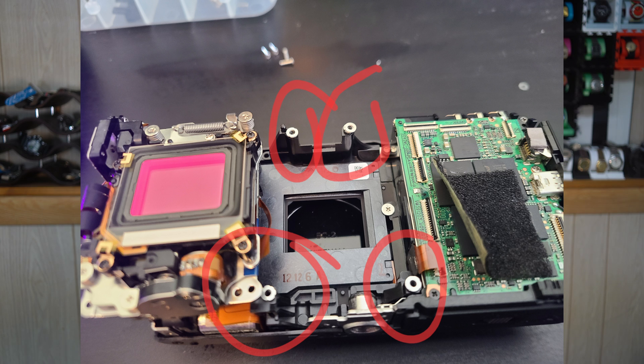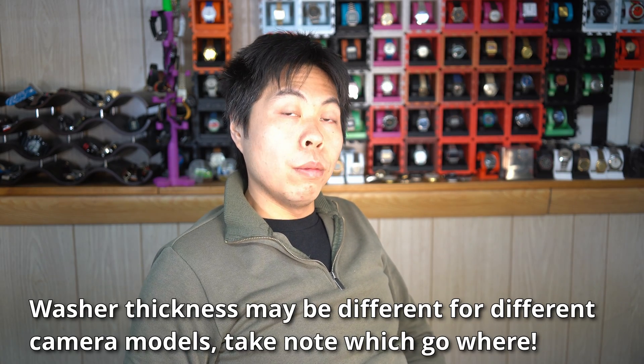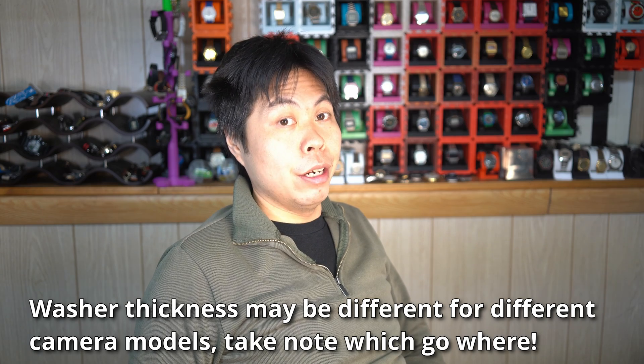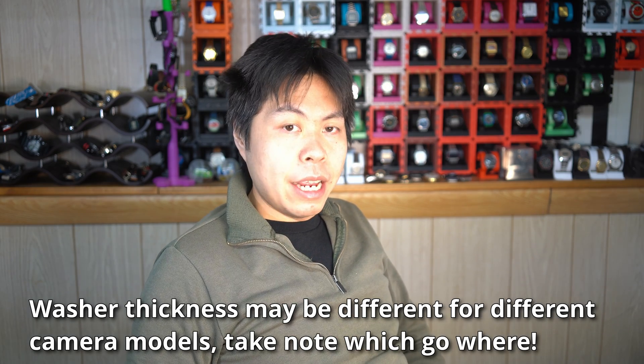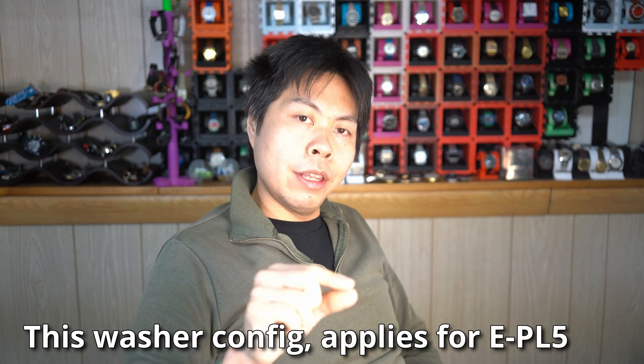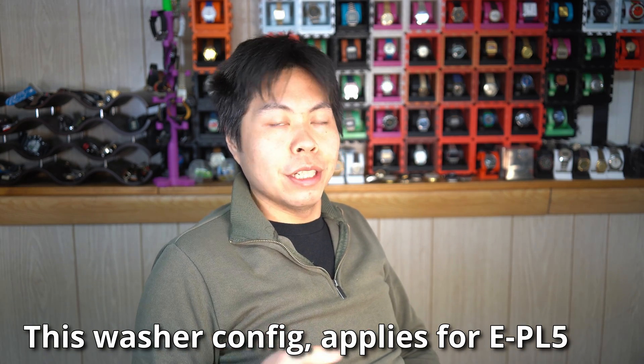The second thing I want to talk about: before you remove the sensor from the camera, beware. There are four screws that affix the sensor into the frame, and underneath those four screws and the assembly there are eight washers. Almost guaranteed, when you get the camera apart, some if not all of them are going to fall out. Don't worry though — it's eight washers, two per screw. As long as you get them back in the correct order you should be good. Put at least one thick washer and one thin washer per screw.